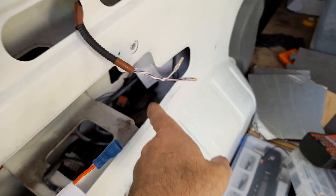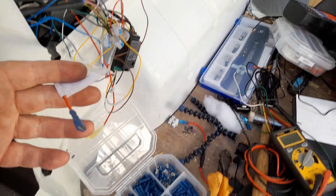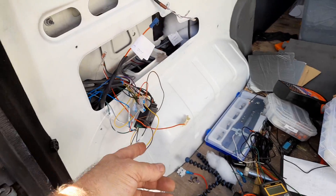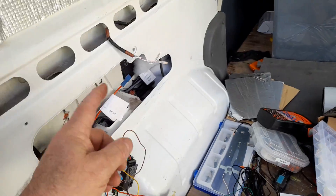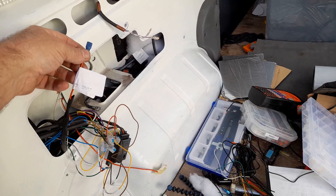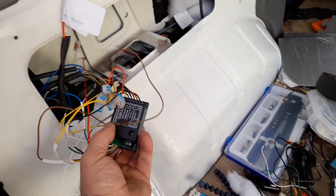That distribution board has been added - this is what I don't get, but I don't care because it just works. Those two 15-amp blue fuses disappear into the dashboard via two green cables, which come out here and turn into red cables - fuse five and fuse six. Although the ignition is off and the key is in my pocket, these are still live - I kid you not.